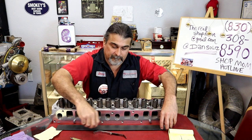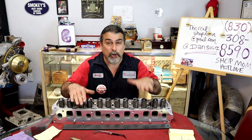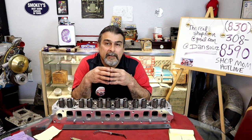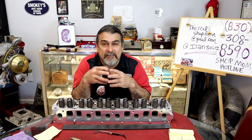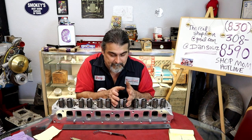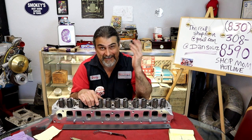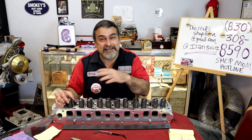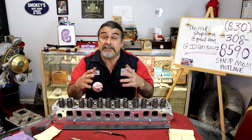Here's another thing that I say. The valves. We got a 30 thousandths lower valve. When Comp ground that cam, they go, hey, let's hit that within 30 thousandths on the base circle. Yeah, within 30 is okay. No. If you have a dyno or a dyno program, turn on that dyno program, put a cam spec in there and change the cam spec by 10 thousandths. You have a different characteristic of an engine. Change the duration a little bit. Change the timing a little bit. Change anything in the cam. I'm talking about a very slight change, and you'll see, you'll change the characteristics of a cam.